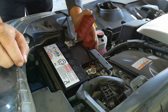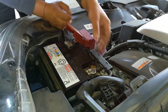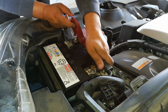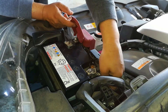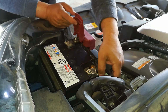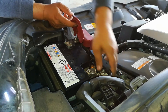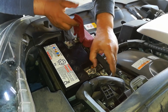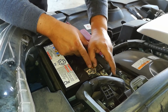What you want to begin with is checking each battery post and terminal to make sure that it's nice and secure, including the wire that's connecting it to the car. This is the black one — the ground cable or the negative side. This has to be nice and tight. I'm checking to see if there's any loose connections when I'm pulling on this, or any hairline cracks that aren't making contact.